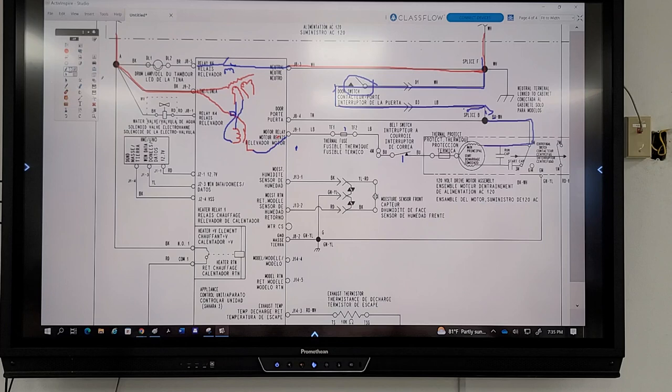And the motor. Okay, broken wires. I know that this wire is not broken because I had 120 here, so that can't be broken, right? No. So now that just eliminated one of three things. If I go here, I can check for ohms.